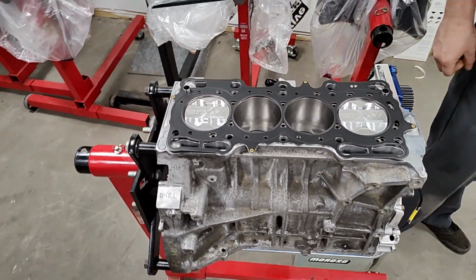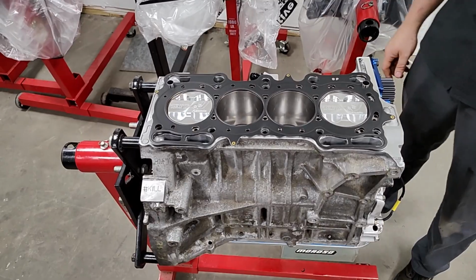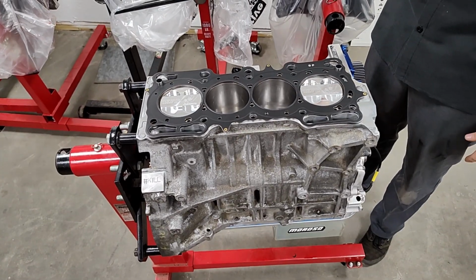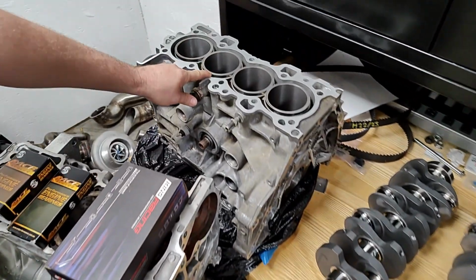So again, copper O-ring you told me before, but this is a pretty standard Cometic multi-layer steel? Regular run-of-the-mill Cometic gasket. That's what we use on all of the builds. We've never had an actual head gasket failure because of the head gasket. The way with all the head studs we use and all the copper O-rings, every block gets O-ringed. I mean, this B series over here is going to be a guy's daily driver, sleeved and O-ringed.